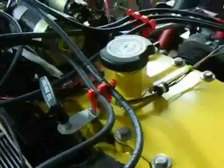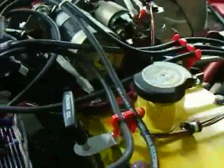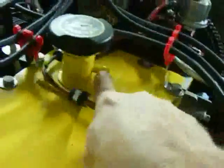There's the oil pan I made with the quick drain plug from a Jabiru. It's got the prop hub on it. They have an automobile oil filler cap and the engine oil dipstick, which keeps it in there and won't pop out. This comes off — there's the breather for the oil system, which you have to have.